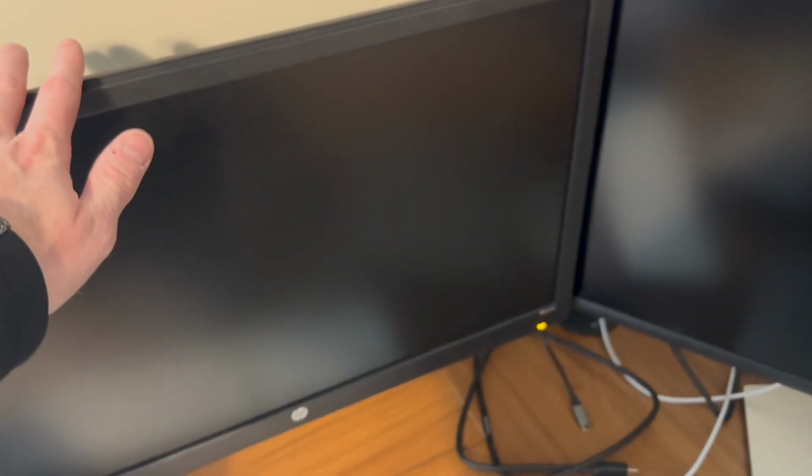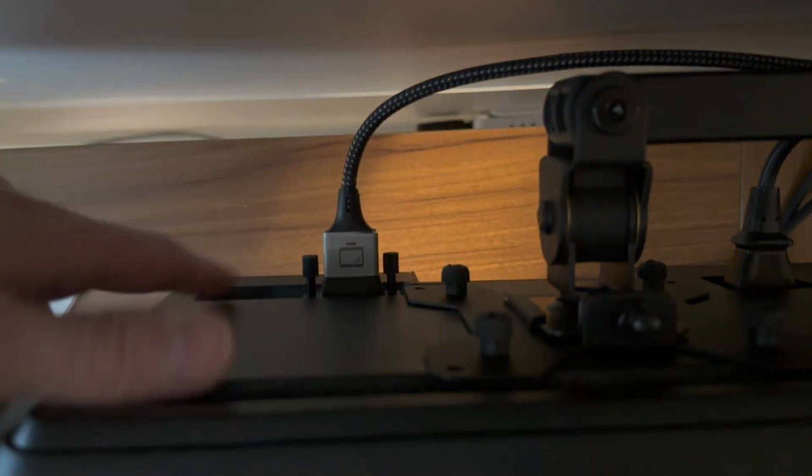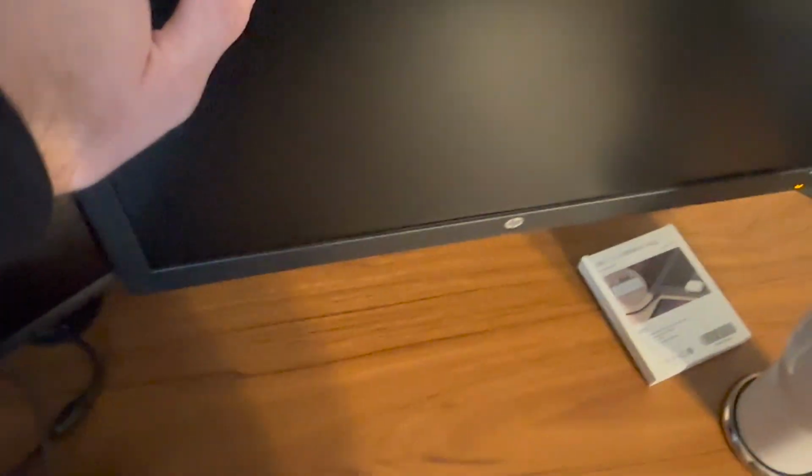So this will be my main monitor, and it will be running on HDMI into the HDMI 1 port. This is my secondary monitor that I use most often, and this will be my other HDMI port. This particular monitor is old, so it has a VGA and a DVI port. So I have this DVI to HDMI cable. Where is that? All right, here's the other end. All right, so DVI to HDMI, this will be HDMI 2. And then this monitor, the exact same thing as this monitor over here. It will be plugged into the VGA port because there is VGA on this monitor.